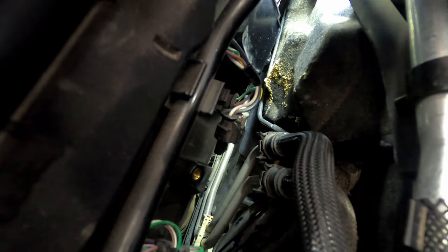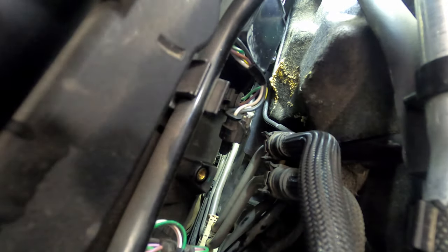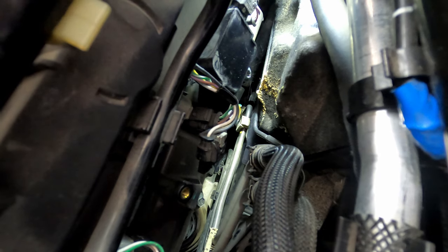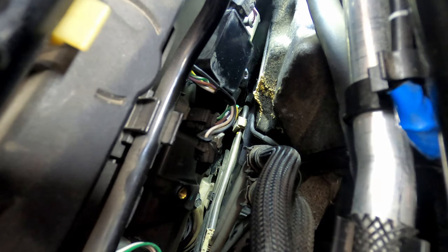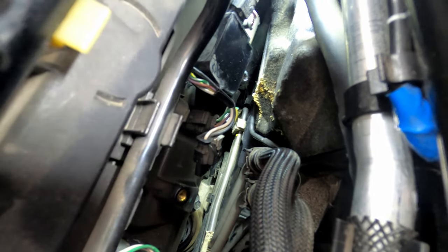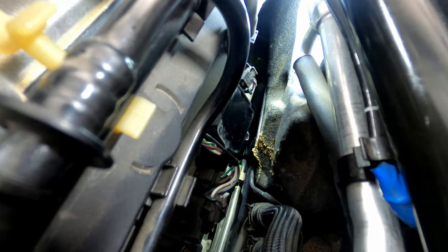And when you plug in your connector, you want to ensure that you push on the connector, not the gray tab. If you push the gray tab in too early, it'll make it really difficult to click the electrical connector on. I think you're going to see that. There you go. That's what I'm talking about. So you want to push the black part of the connector on first, then lock the tab once you have it on. So, I'll show you an example of that.